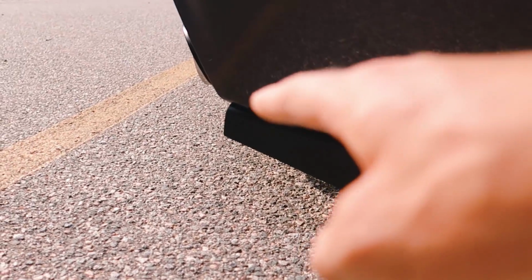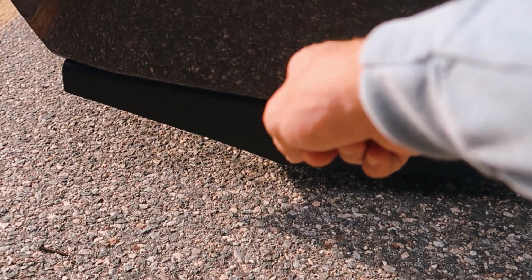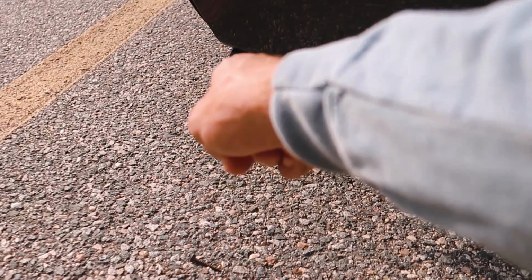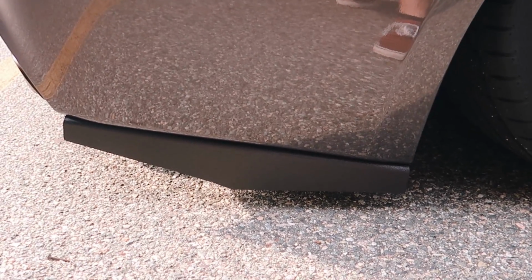As far as dimensions go, this is the easiest thing in the world. Ready, guys? From this point up to this point, it's 20 inches. Go 3 inches up on each side, and then measure 10 inches so you're in the middle of that line. Go down 4 inches in the middle, and then just take your mark there, connect it to that mark, and vice versa on that side. So it's symmetrical, and I think that made it very easy to make.